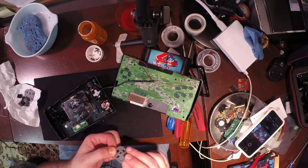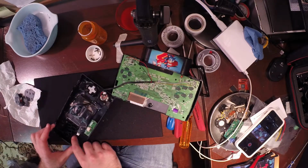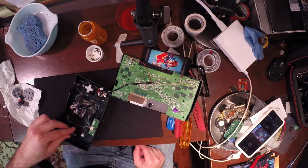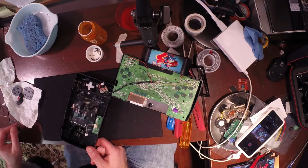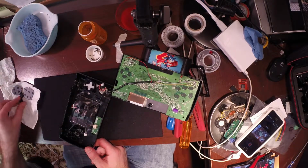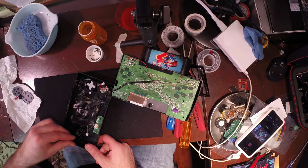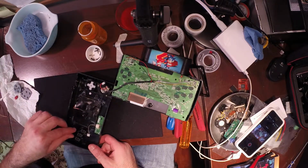This is what presses down on the D-pad, the directional pad there. So I'm going to show you how to put those buttons up. Now what's fortunate about this is that, kind of like blocks in the shapes when you're a kid, it won't fit if it's not meant to go in there. So the gray buttons, if I recall, are going to be on the bottom, aligned with the select and start button control pad there. So I just threw the black button in like a doo-doo. And so we got our gray ones lined up in here, just like so. Get the rest of our blacks.